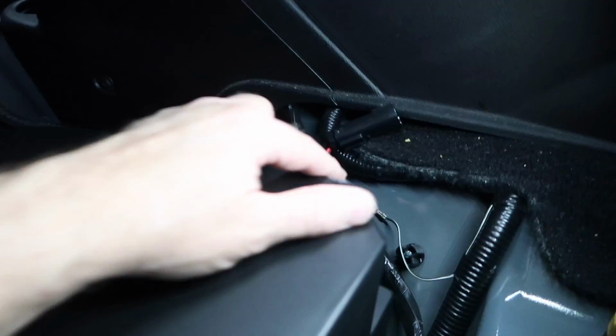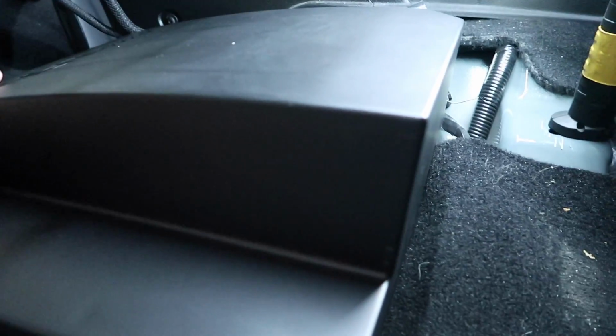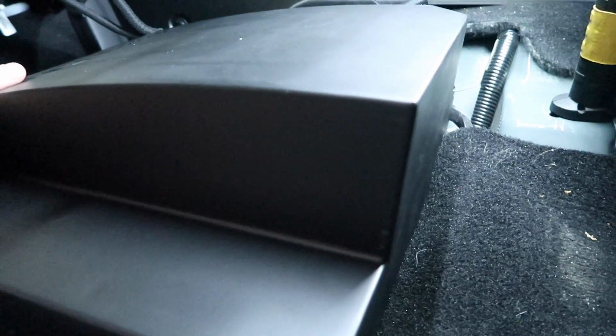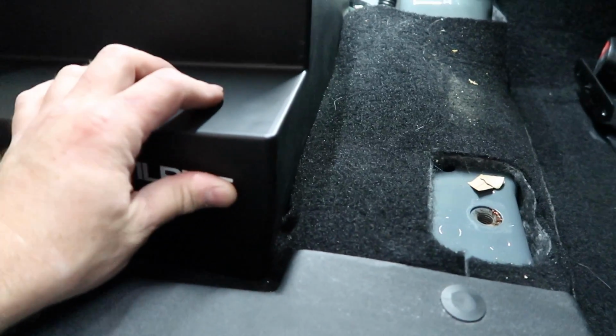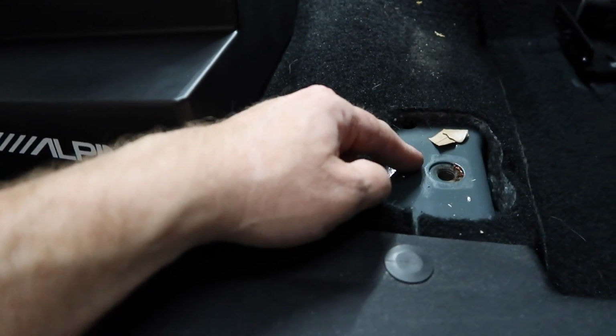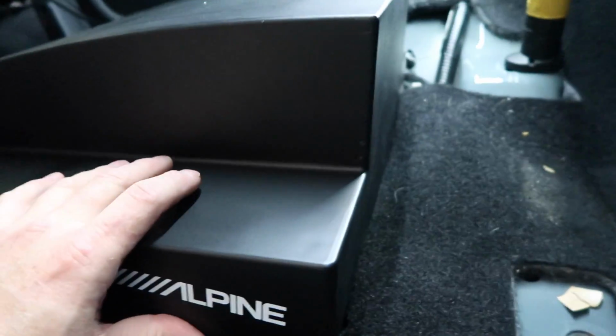This guy here never actually touches the top of this, but as you can see, when you're bringing this sharp metal seat down, it's got to kind of slide forward like this as you put the seat on top of it. And then the seat, as you can see here and here, is what's gonna hold this thing in place like this. And you have to kind of push it forward some once you get it in there, because you have to get this seat bolt. It wants to sit back 1/4 of an inch. That's why I feel like if they had made this a little bit shorter here, it wouldn't have been an issue. It would have snugged right up in there.